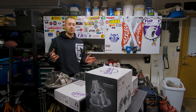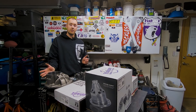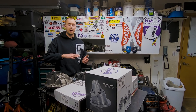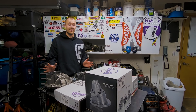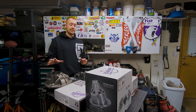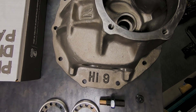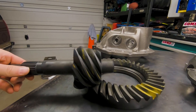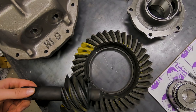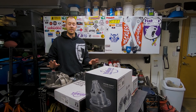The center section uses the Ford 9-inch dropout third member. I could just get a typical low pinion third member, put it together and be good to go. But the Ford 9-inch has a very low pinion, and I don't want that to catch on rocks or sacrifice driveline angle. So I decided to go with a high pinion Ford 9-inch. Ford never made a high pinion 9-inch — this is a totally custom setup made by a company called True High 9. They're the only company that can make a true high pinion 9-inch, with their own proprietary cast iron third member and the only machine capable of cutting reverse-cut 9-inch gears. No other company has the capability to make this type of differential.